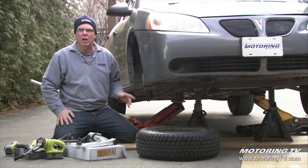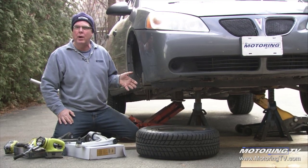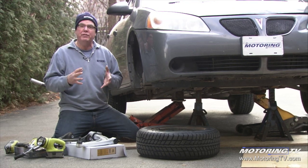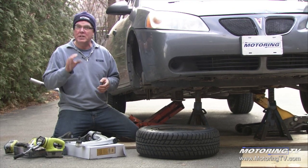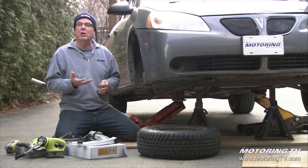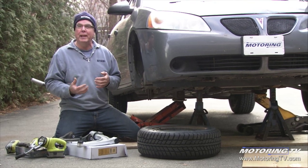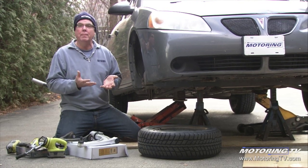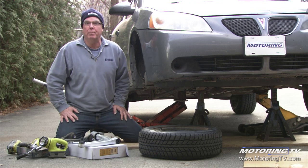This lower ball joint is what we call a follower ball joint — it's not a load carrying ball joint. It depends on the type of suspension you're talking about, and the method of testing them is very different, so it's definitely a job for a mechanic. On a load carrying ball joint, you've got to lift the vehicle by the control arm to reveal the play. On light duty vehicles, if you lifted it by the control arm, you'll damage the control arms on many vehicles.